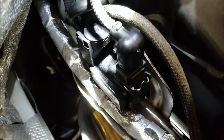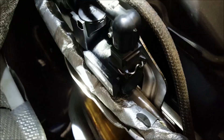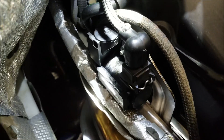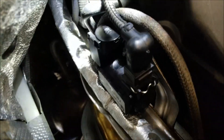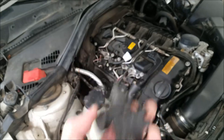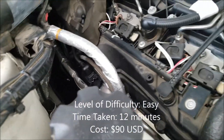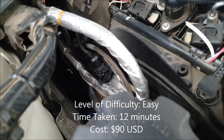There's the new part all in. Snugged up the nuts to a couple of pounds — just finger tight. Not going to get a torque wrench in there. Just remember you're torquing down on a plastic flange. Got the two little vacuum hoses in, got it plugged in. Time to start it up. Old part, new part — I don't hear any buzzing noise at all. Drive it for a while and see how it works out, but I'm pretty sure that'll fix it.